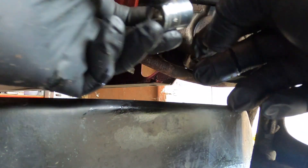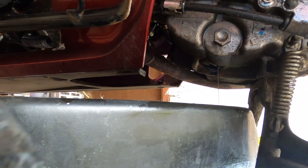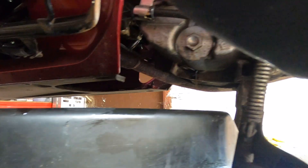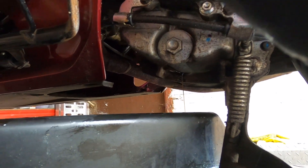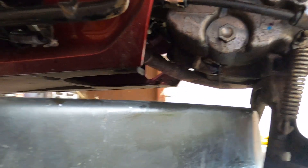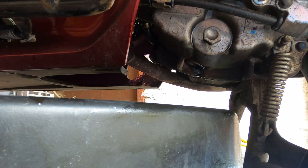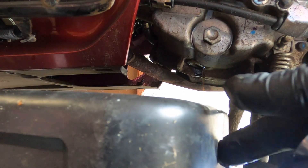Here's the 17 mil, and this is effectively your oil cleaner - this is the mesh that filters it. You get a similar thing on the old air-cooled monsters. You normally clean the mesh out on the monster while you're doing the oil change as well.